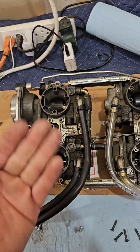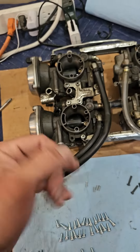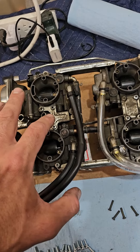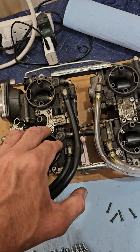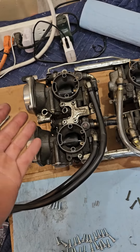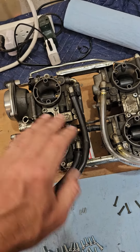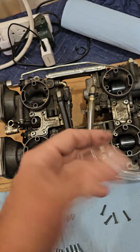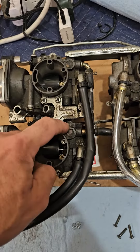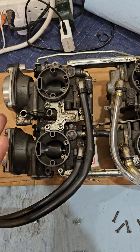How do you guys do it? I know how I do it, but I'm curious how you guys do it — because maybe I'll find a better way. I personally don't like hammering on stuff, especially these carb bodies, because they're hard to find. I have a way to remove these plugs — it destroys the plugs, so I always order new plugs with new O-rings. You'd want to replace the O-ring in here anyway. Pull this plug off — there's an O-ring in there that seals this plug. Why put it back? It's pointless.